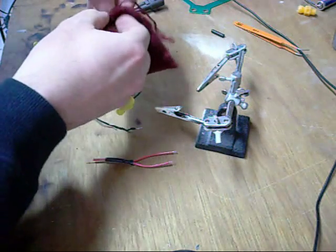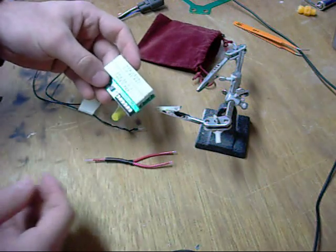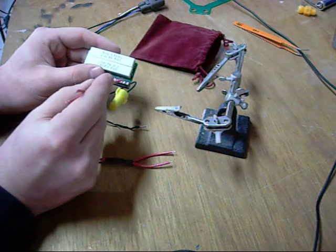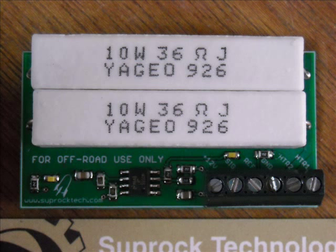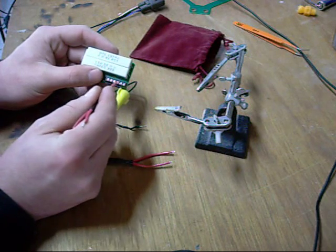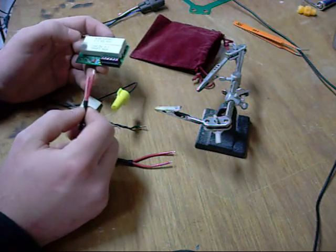I'll open the simulator — they come in this velvet bag. There are a number of things written on the simulator which is kind of hard to see on camera, but you'll see there's a 12 volt, signal, reference, ground, and heater. There are two heater lines right here. What you've got to do is wire the 12 volt into the 12 volt terminal and also into the heater, and that's what the wishbone is for — so that you can power both the heater and the simulator off of the same power source without having to run a separate line.